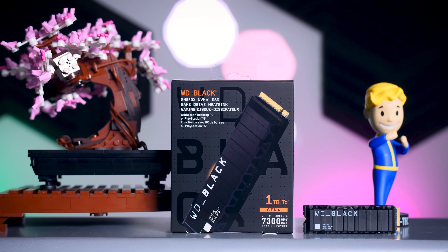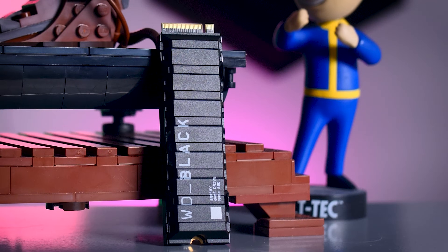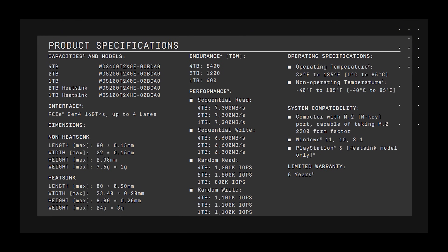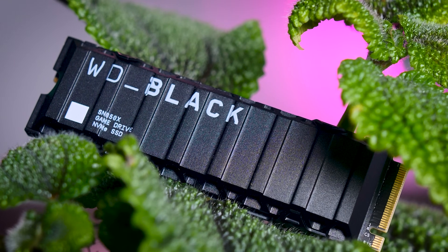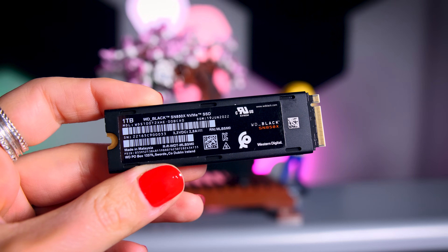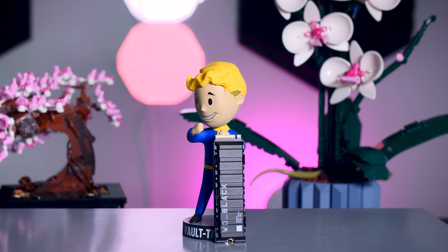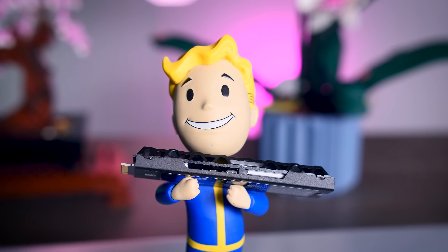Just like its predecessor, the SN850X is a high-end SSD and it comes with all the bells and whistles you would expect to see on a high-end drive. It is a TLC drive, it has DRAM cache, and it has SLC caching. Though the specs on their own website are a bit vague, and I kind of expected more transparency for a brand this large. They do offer a five-year-long warranty, but there is no mention of hardware encryption anywhere, so keep that in mind if that is important to you. When it comes to capacity, they dropped the 500GB version and you can choose between 1, 2, or 4TB models. This completely makes sense because SSDs have become quite cheap, and anything under 1TB just has a very poor price-to-capacity ratio and it's just not worth getting.